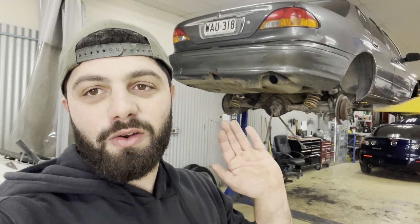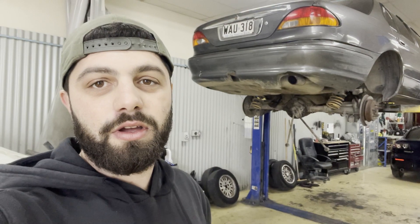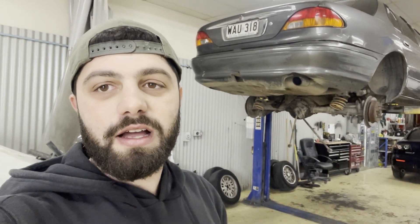So for now we're doing choppies, and I'm going to show you the proper way to do choppies. I don't like seeing people cut springs in cars while they're under compression, so always remove your springs if you're going to start chopping stuff and be safe about it. I've already sort of started, so I'll just swing the camera around and show you guys what I've done.